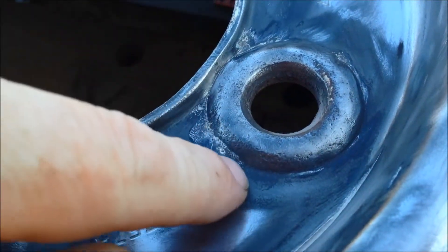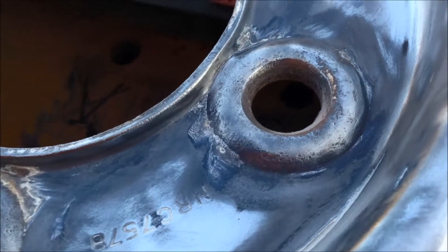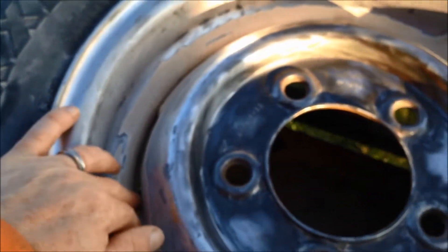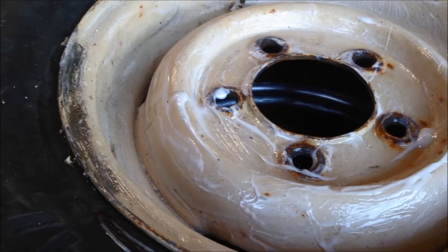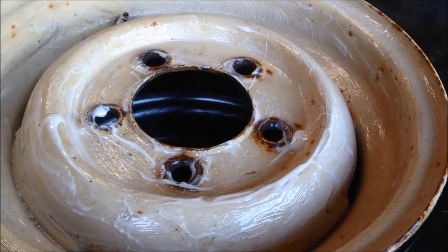You can see there's still tiny bits of paint just in these awkward places here. So what I'm going to do to get rid of the stuff that I can't reach down at the bottom, down these edges, I'm going to use paint stripper. For this wheel, I've not ground anything away — I've just put this paint stripper on there.